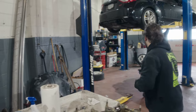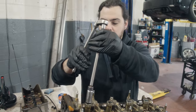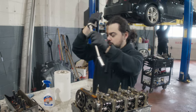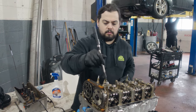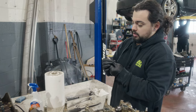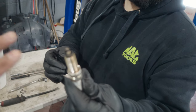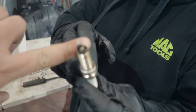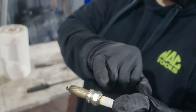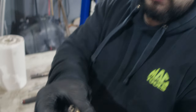There you go. Not bad either. So what are you looking for when you're inspecting these? A few things — you want to see if it's burnt at all, maybe if it's soaked. There's a little bit of blow-by, but that's kind of normal. Yeah, this one's pretty clean.